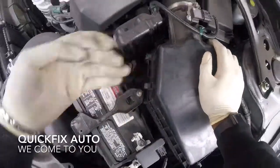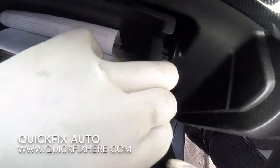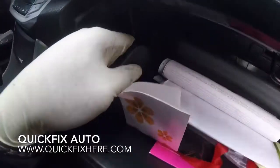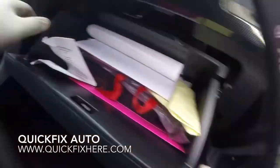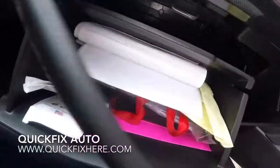Here's your clips and that's done. Come to the glove box, and what I like to do is just push these tabs in — here we go — and now you have access to the cabin air filter.